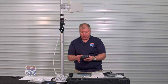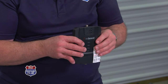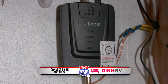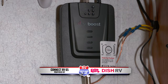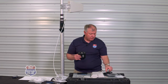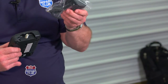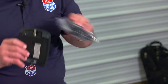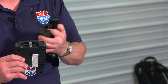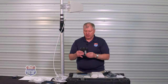Inside, we mount the booster unit, which provides a 32-times signal boost on 3G, 4G, or LTE networks — Verizon, AT&T, and all carriers. It will be permanently mounted in a cabinet out of the way where the coax cable can reach it. It needs power but offers two options: a 120-volt source converted to 5 volts, or a 12-volt connection. So for boondocking, you don't need shore electricity to run this system.